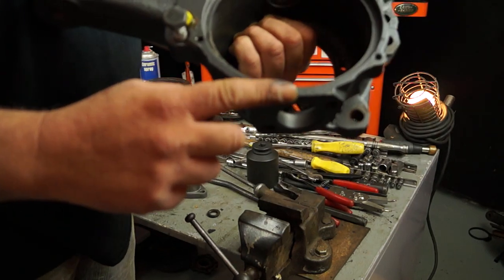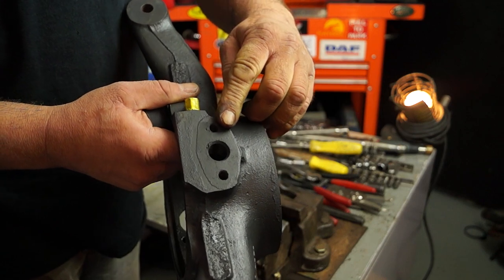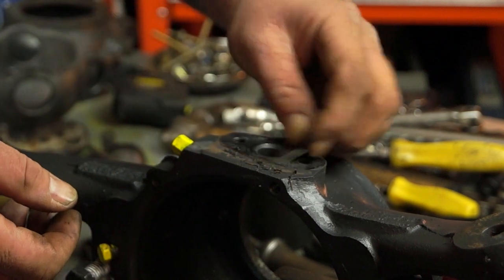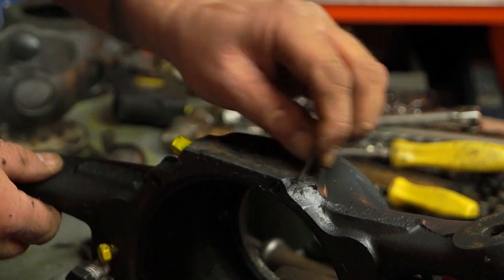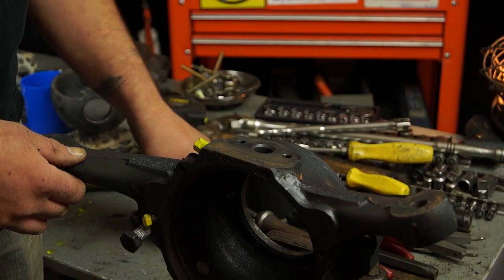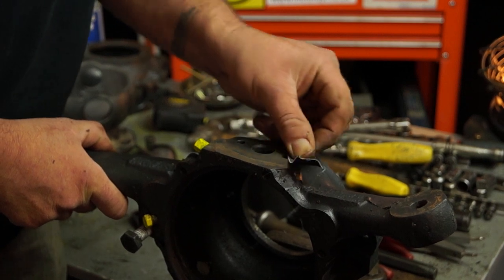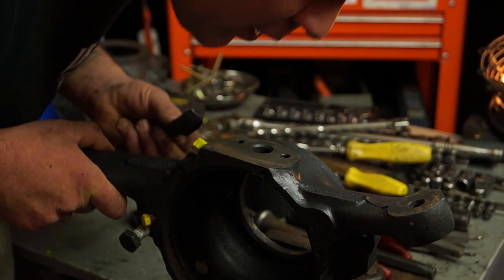Just keeping this video short — I've actually cleaned and spray painted this, and painted the bung plugs. This is more for demonstration, but I've left the gaskets on, which I'm going to remove with a Stanley blade. It's easier this way than having to scrape all the paint off. A sharp blade is pretty good for removing stuff quickly, but you'll also want to scrub the mating surface so you've got a nice clean surface — almost like you'll be doing a head gasket.